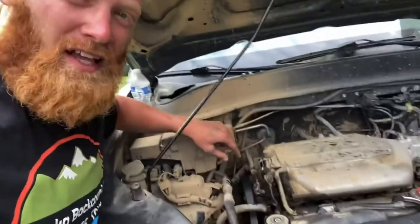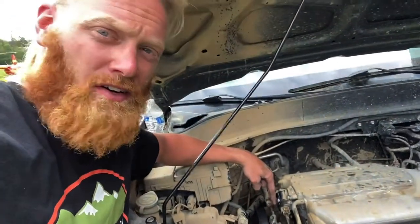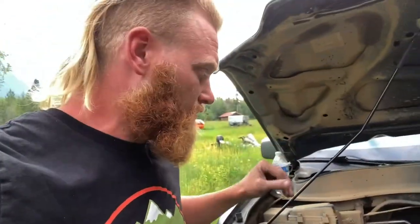So it sounds like it's right here, right in there, which I've been told happens when the O-ring goes out — they're notorious for doing that. It's because the O-ring is too compressed and it's actually sucking air in a little bit.